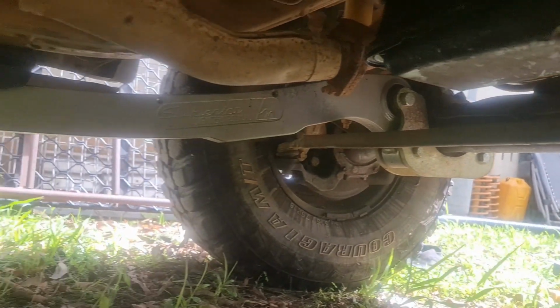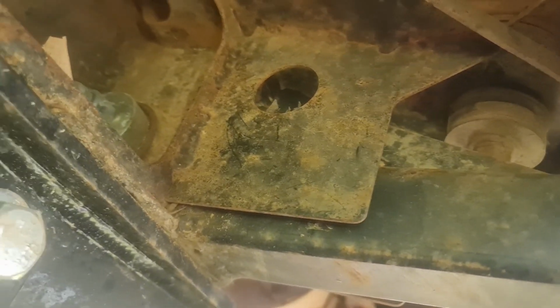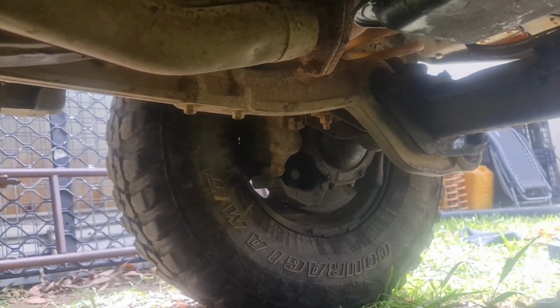So we gotta pull all this apart, and we gotta pull all the front ends apart as well. Don't need to take the shocks or anything out, just the arms out. But when we take the arms, we're also going to get the side steps to pop off, so we'll get those sliders off and they can be ready. We do have to drop the gearbox mount, so we're going to need the jack under here to jack that up a little. That's the passenger side swapped out.